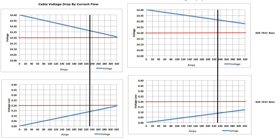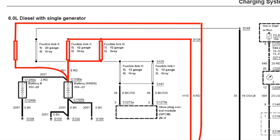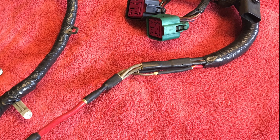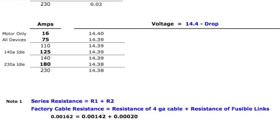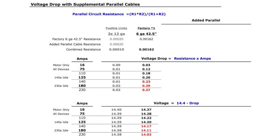Compare this to the visual cable lay. Time to start walking in the tall corn. We have to deal with the series resistance if we want to do this properly. We have two parallel fusible links that form a series circuit once they're paired with the rest of the cable. As I showed in the video on negative and bonding cables, parallel wires or cables act like larger cables due to the lowering of resistance. The resistance of these two fusible links combined is half. The fusible link resistance is in series with the rest of the cable, so they are summed together. Now we have the actual resistance of the factory alternator cable, not just 18 inches of 6-gauge cable. The voltage drop is just resistance multiplied by amps.